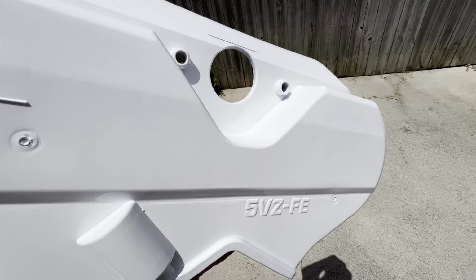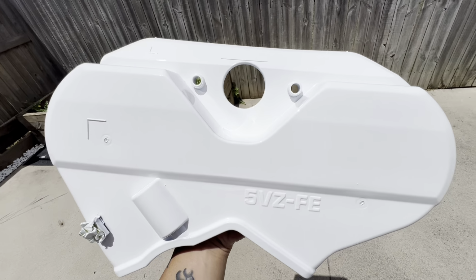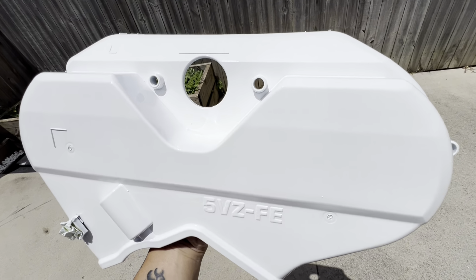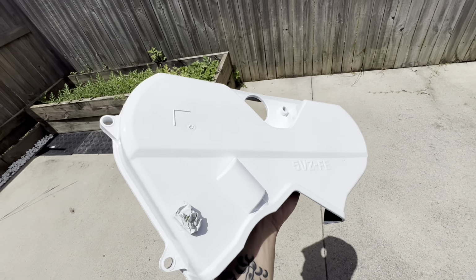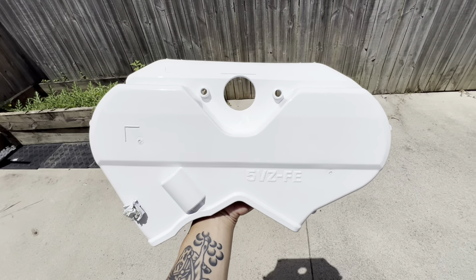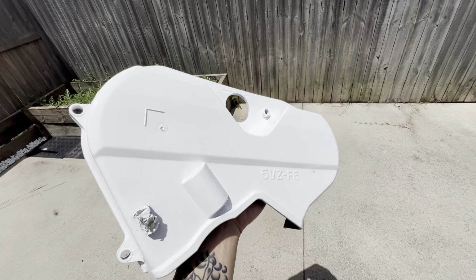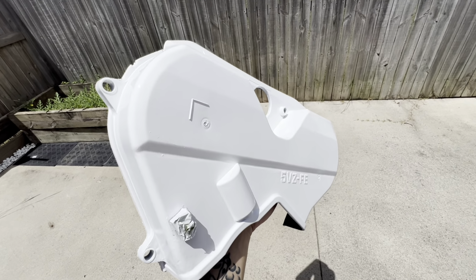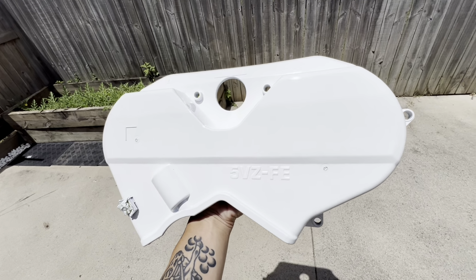It takes a while to sort of learn your limitations on what paint you're using. Obviously, you're going to get runs and stuff like that. But as you can see, I don't have a single run on here. There is no runs, and it's just glossy as anything. So once you learn the limitations of what paint you're using, just go super heavy with it. You just get to that point just before it runs, and then, yeah.